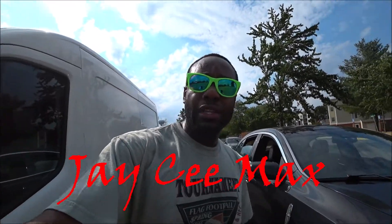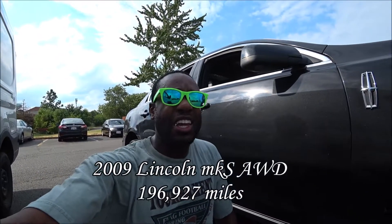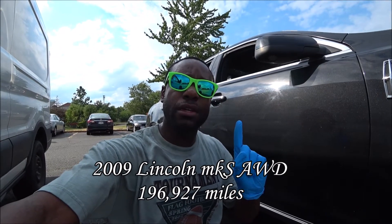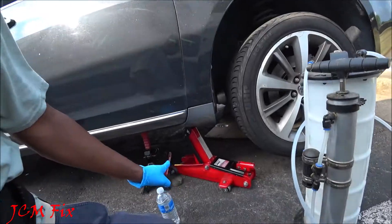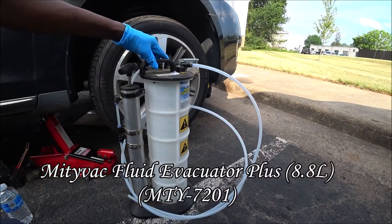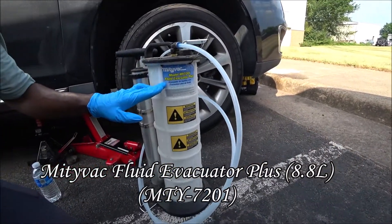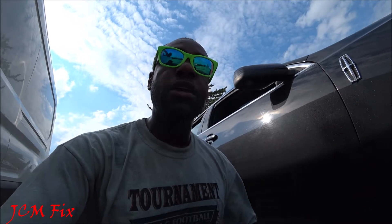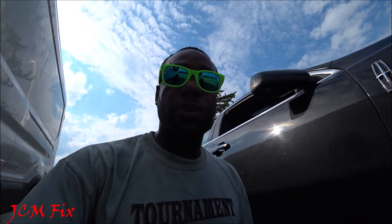We're back with the 2009 Lincoln MKS. What we have today is a power transfer unit drain and fill. This car is at 196,927 miles and I don't think it has ever had a PTU drain. I'm going to go underneath the car and drain it properly with this MightyVac Evacuator Plus machine. After pumping everything out, I'll place new 75-140 fluid inside, drive it around, and drain it one more time because I think it's been since 2009 that it's had fresh gear oil in the PTU.